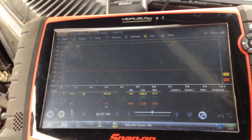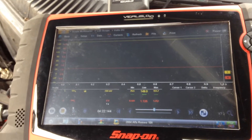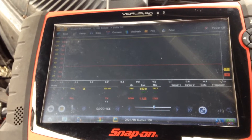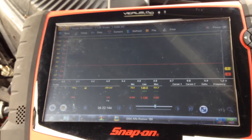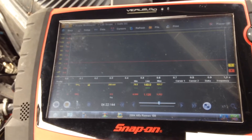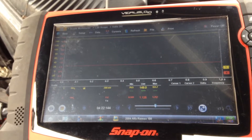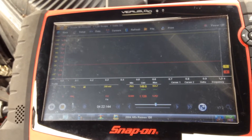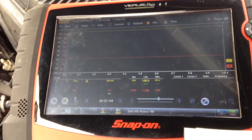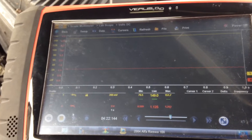These sensors can be identified by having a supply voltage normally between 10 and 12 volts on one wire and a voltage close to ground on the other wire. Some sensors can have the output voltage or output frequency on the supply wire. This is slightly different to test with an oscilloscope as you have to couple the waveform to AC in order to see a signal. The signal on this active wheel speed sensor is on the low voltage side, so we will be using a scale of 5 volts to monitor that.